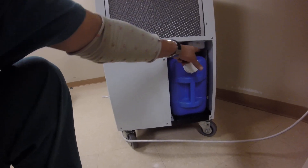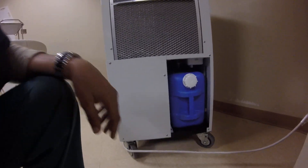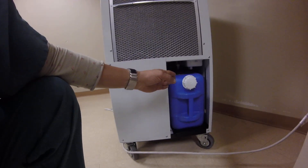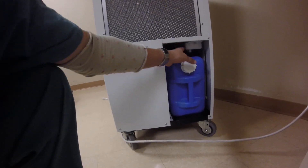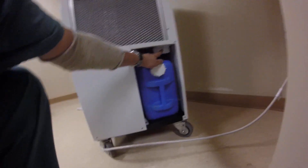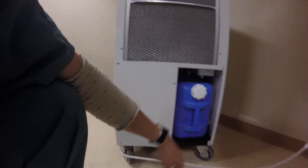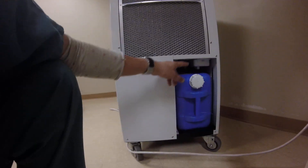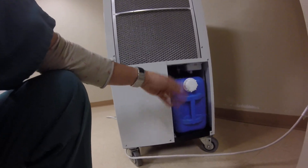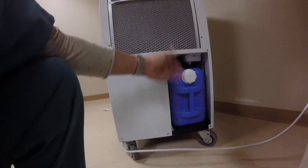When that happens, the water will overflow everywhere and then comes out and wets the floor. So I recommend at least every four to six months, open up this tray, bring it out — it comes out really easy — clean up the mess, and put a little coat of bleach along the styrofoam. Because it may be a little mildewed and have a smell, then put it back and you're in business.